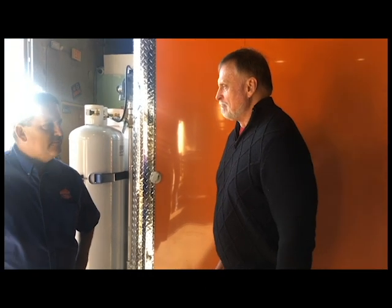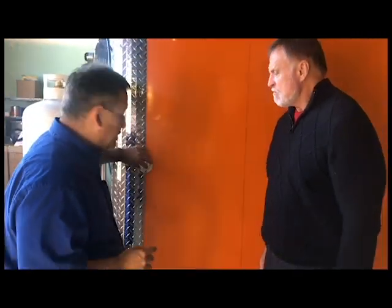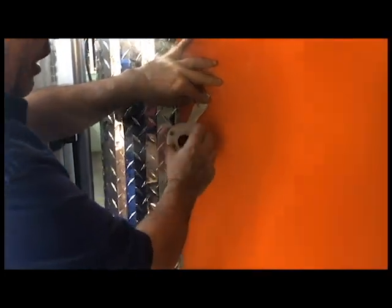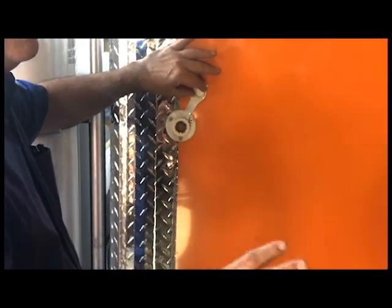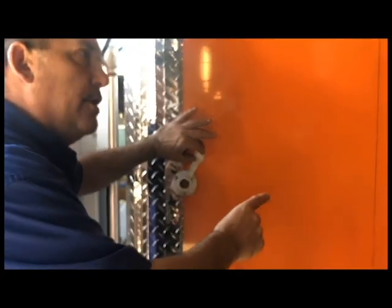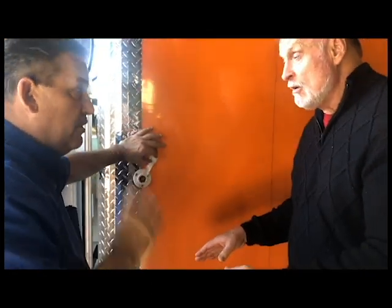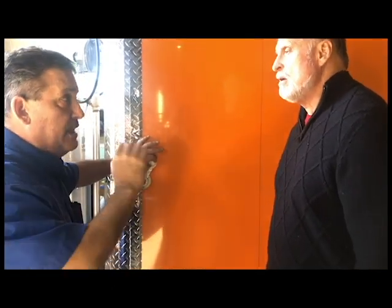What's the next step, Larry? Now that we have the power switched off and the valve open, you're just going to connect the hose to the water inlet — screw it on and then turn the water on. The water supply doesn't have to be at full power; just turn it on a little bit for a nice steady flow. About 12 minutes later, you'll hear water coming out of the tank at the overflow — that's when you know it's full. You'll also see the water rolling out from underneath the trailer.